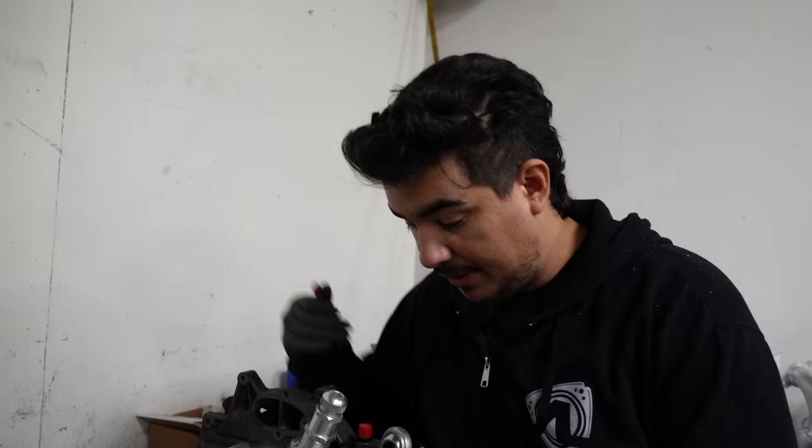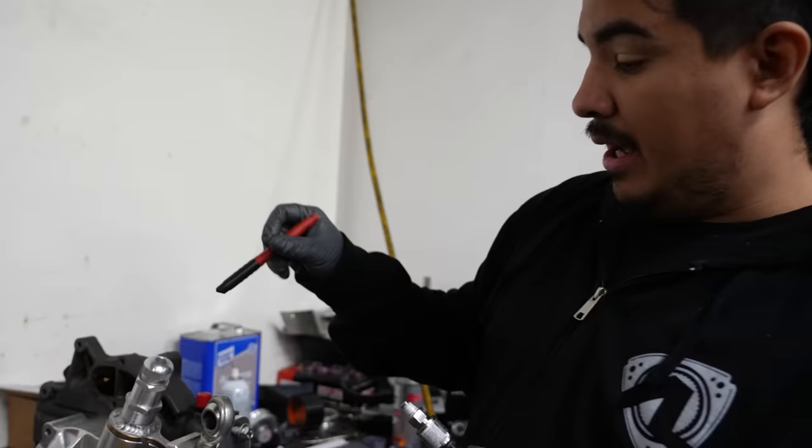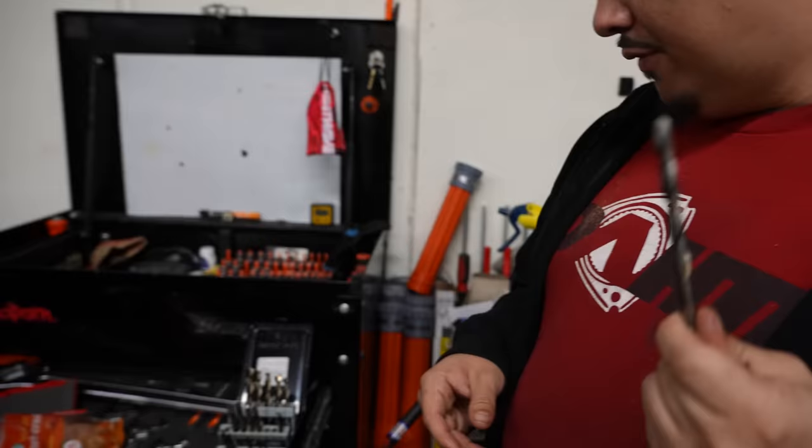When you're doing things like this, that data is actually very, very necessary, because what's happening with the control rings, what's happening with the oil pan gasket being sucked in, all that is very, very crucial when you're doing all this crazy stuff. So I was originally going to weld it somewhere over here, but with this being so close to the seal over here, I'm just going to drill and tap. This is an 1/8 inch MPT, 5/16 drill bit. I already have my little pilot hole drilled in there.